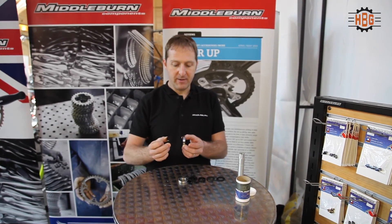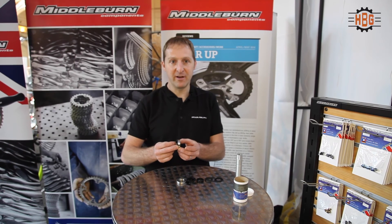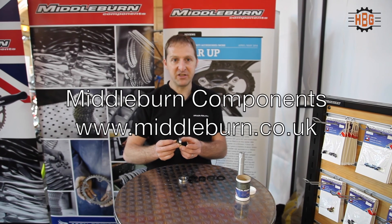We then add a 7.5mm spacing, so this replaces your step-down spacer and washer that you'd normally have as a conversion kit. This is a lot more durable — your cranks will still spin better and will last a lot longer than the conventional BB30 upgrade system.